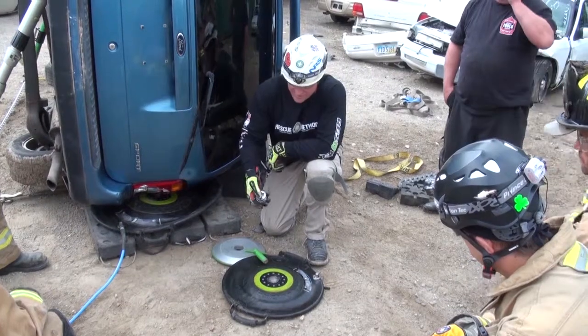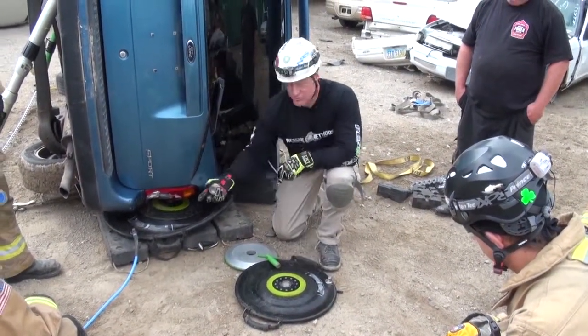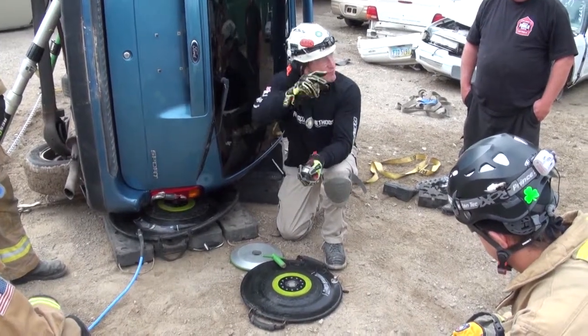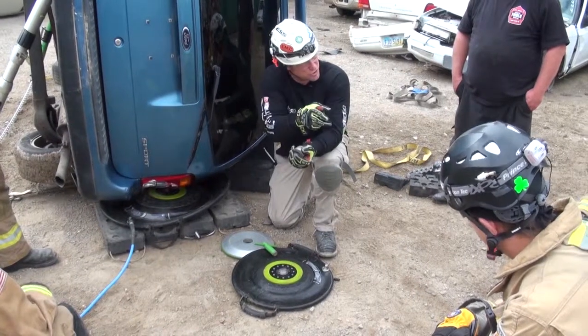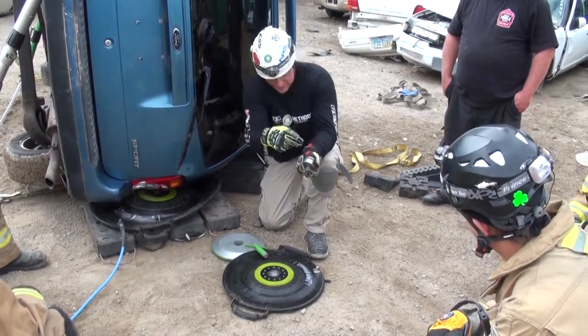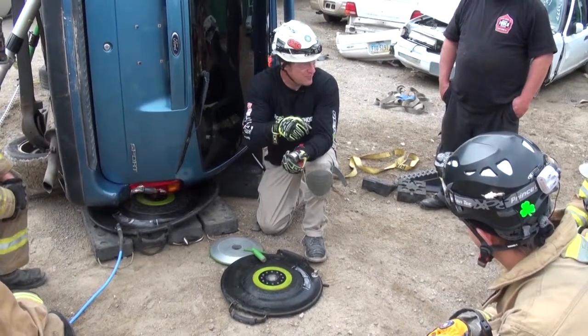Tremendous safety facet. When you do that, I always like to orient my fittings so that they're both the same — both of them on top, both of them on bottom. When you spin it down, those fittings should end up in line or on the same side of the bags with one another. If they don't, you have not fully seated the airbag.